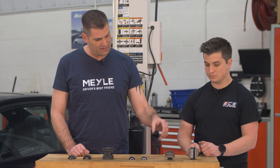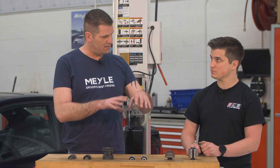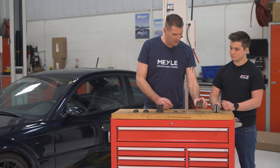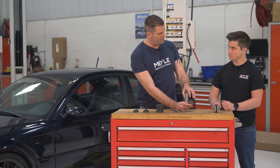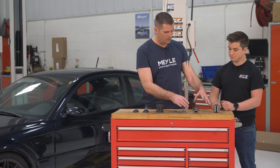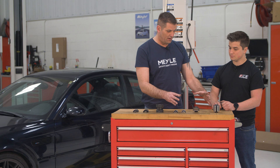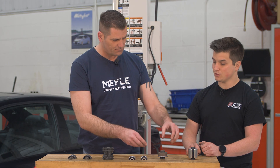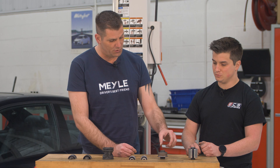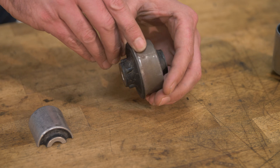As we already said, last time we spoke about these pre-compressed bushings — the one for the BMW E-Series, which we also have available for the F-Series, but it's a different type and the slot bushing looks a little bit different. That one is quite interesting because people do not have the problem of having to compress it by themselves — it's already done in the production process. We take the outer housing and the vulcanization of the rubber, get them well connected, and then a crimping machine does the pre-compression. You can see all those marks on it — that's actually where the tool is crimping the whole bushing together.